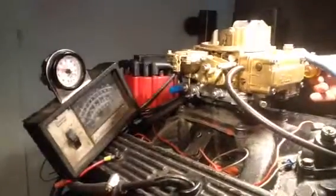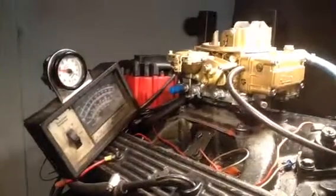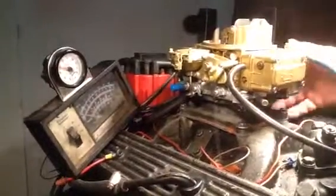Your motor's hesitating, you probably got slow timing. You want 30 degrees at 3,000. Air fuel ratio of 12 to 1 to start out with, and that's exactly what you got right there. That's the ideal mixture right there at 12 to 1 to make a good, clean, burning flame — inside or outside, 12 parts of air to one part of fuel.